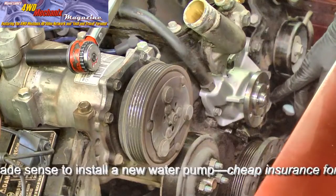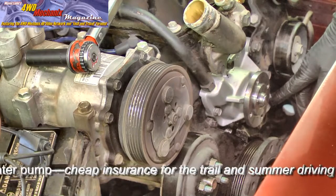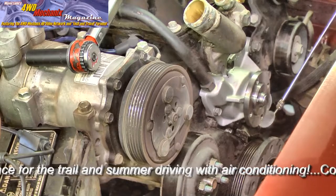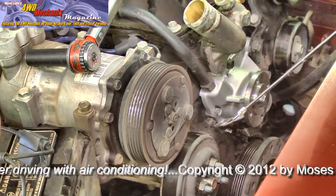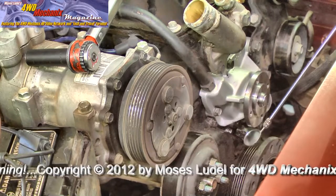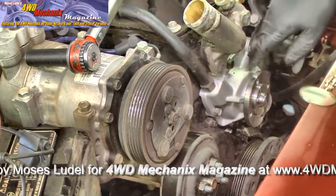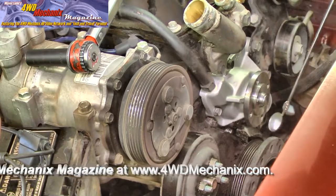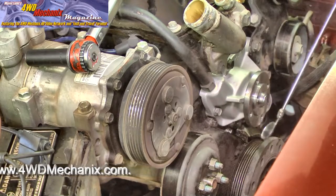Taking a closer look at the water pump to hose flange — it is more accessible than I originally imagined, so I'll put the hose on now before the radiator goes into place, but with the pump already installed. The final step with the water pump installation is to go around the entire pump and make sure the gasket is in place and aligned with the edge of the pump. Use a mirror if you need to, to make sure the gasket is aligned with the bolt holes as you install the pump, and check afterwards if necessary.